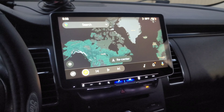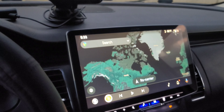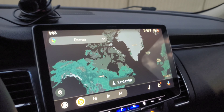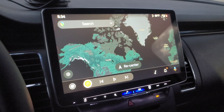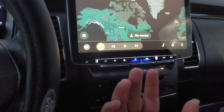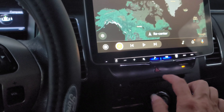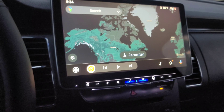With the dash kit, you are going to have to customize it slightly and make some adjustments, because at least with this radio in particular it won't sit in there just right. I know there are a couple of holes that need to be drilled because of the way this sits in here — the radio sits at a slight angle and the brackets are kind of straight, so they have to angle the brackets. Obviously the CD player is not going to work, but it's not like I need a CD player anyway.